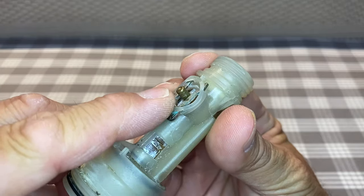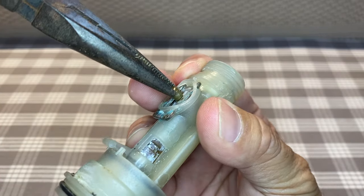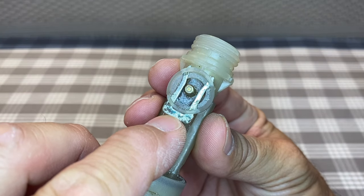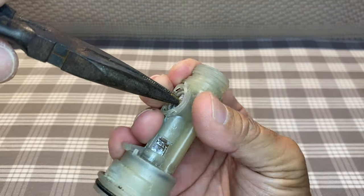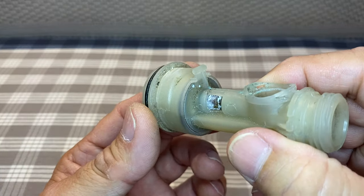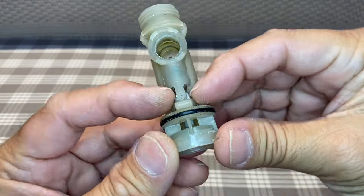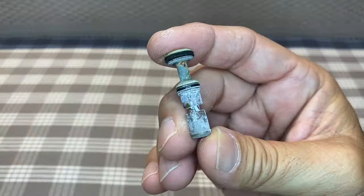The pause valve is supposed to automatically spring open, but I needed long nose pliers to pull open the valve. This retaining clip holds the pause valve in place, so I removed the clip to remove the pause valve. Here's a look at the spring and mineral buildup on the valve plunger. It looked like the valve body could be separated, and I was right — sliding the diverter forward allowed me to pull it out. Look at the mineral buildup.